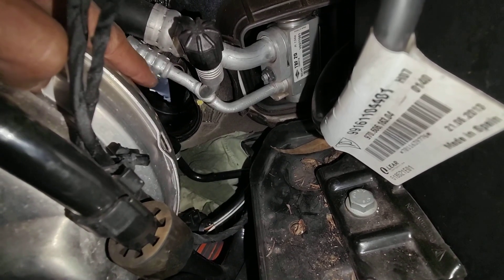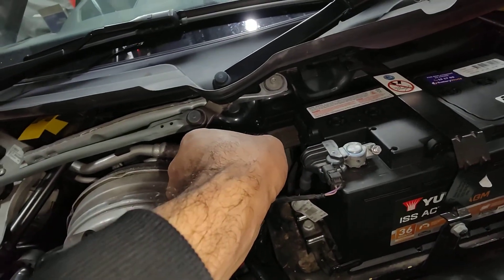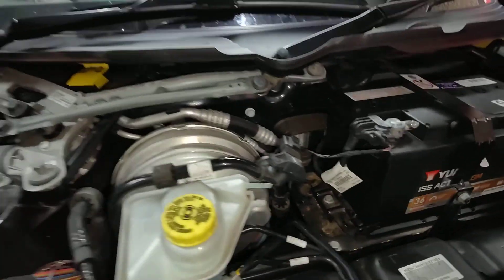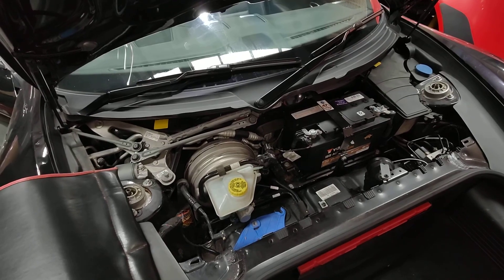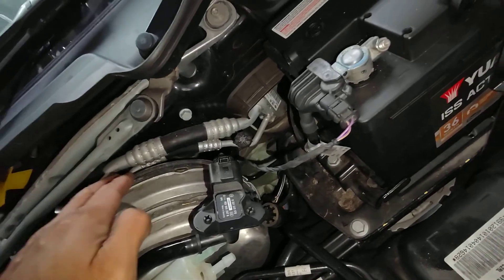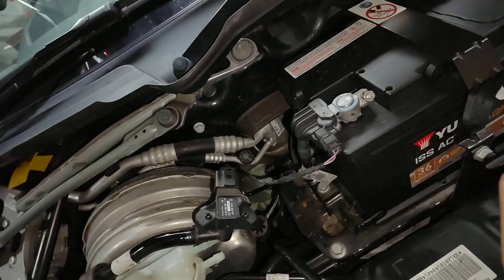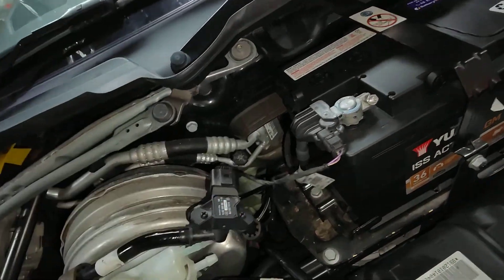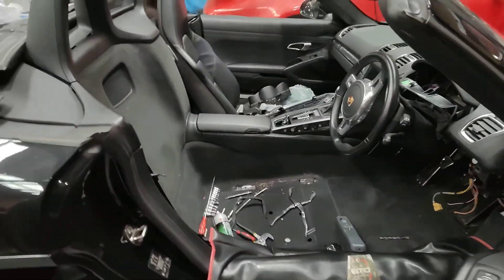The way you take it off: you grab it, turn it to your left, and take it out. There are no screws holding the slave — it's just a turn-lock fitting. You turn it and move it out, then come sideways out this way, not from the inside of the car — it has to come from this side here. We finally got it out, so now we're going to put the new one on and refit everything.